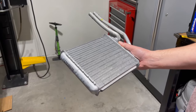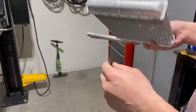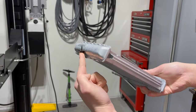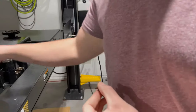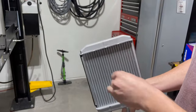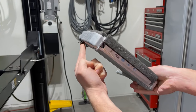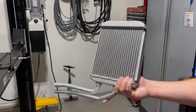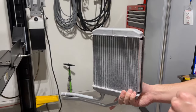Here we have our new GM heater core — we'll link the part number in the description below. I want to show you why I recommend buying one of these GM heater cores. When it goes in the truck it's going to sit at an angle, and this is the clip that holds it in — it hooks on the edge, and the screw goes straight up and down to hold the heater core in. If you decide to buy an aftermarket one, all of the aftermarket ones have a different style end tank — a lot bigger. When you go to reuse your clip, the screw will no longer point straight up, so you're going to have to basically remake a new clip. Honestly it really doesn't fit that well with those bigger end tanks. So I think this is one of those situations: spend a few extra bucks, buy the GM heater core, and skip the aftermarket one.